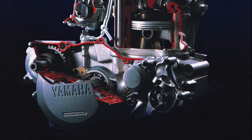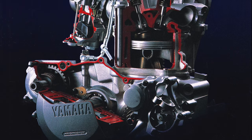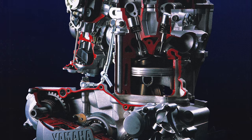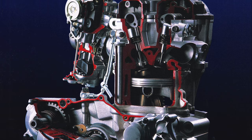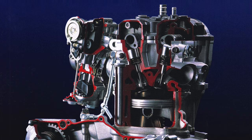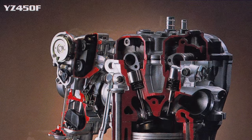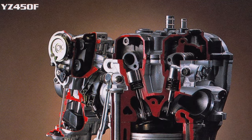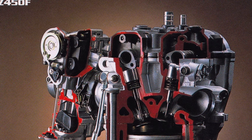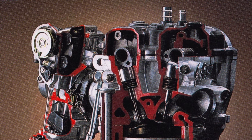On the motor front, Yamaha retained the same basic dual overhead cam layout and five-valve head they had used since 1998, but added 3.3 millimeters of stroke to raise the displacement to 449cc. An all-new cylinder shed weight by dropping two bolts from the cylinder base, and a new head lowered the center of gravity by reducing its height by 7 millimeters. The valves remained titanium in construction, but were slightly shorter and 18% lighter than in 2002. Paired with the new valves were more compact springs and repositioned cams that allowed for a straighter valve angle within the head.